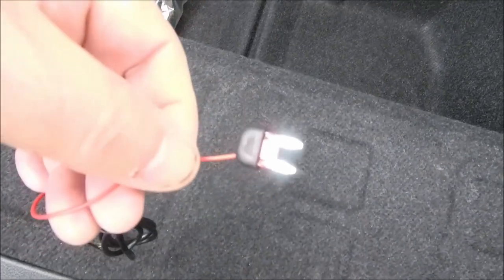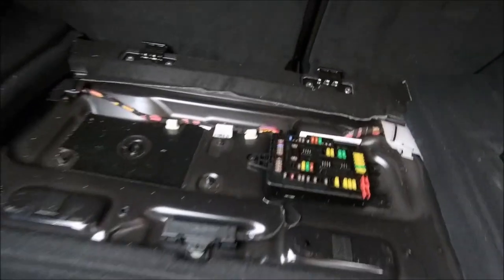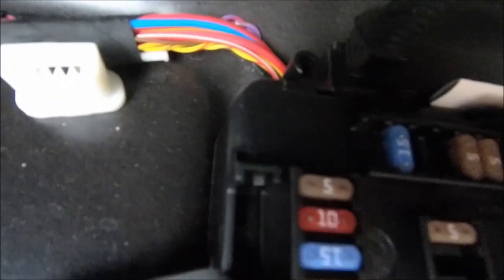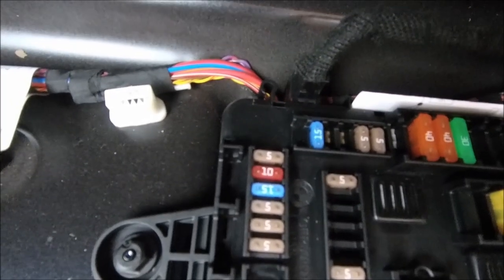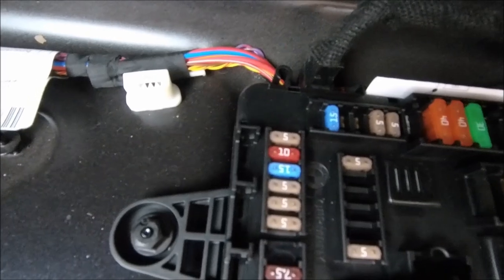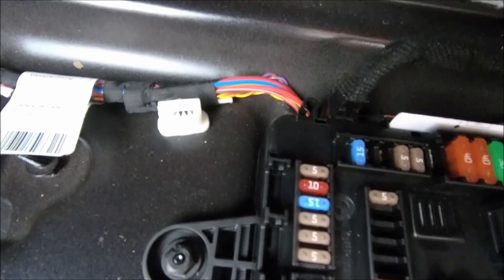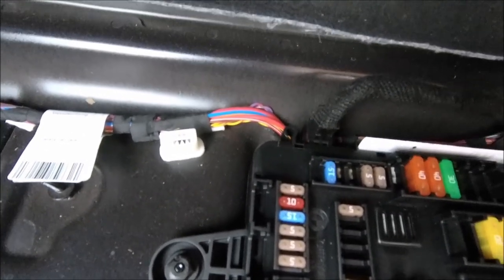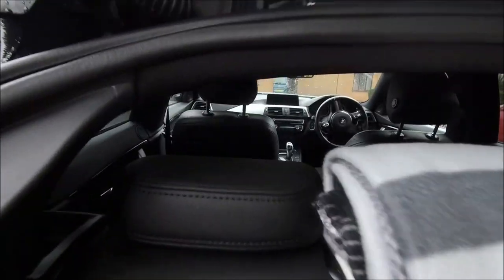As you can see from the wire, it has an inline fuse and an earth strap, so that needs to be wired into the fuse box itself. The fuse to use is the back one — the five-amp one. It replaces the fuse but also powers the dash cam. That's a switched supply, so about 10 seconds after switching the car off it disconnects power.